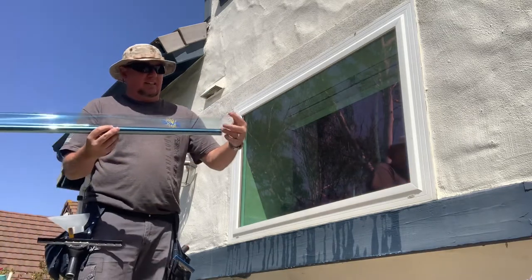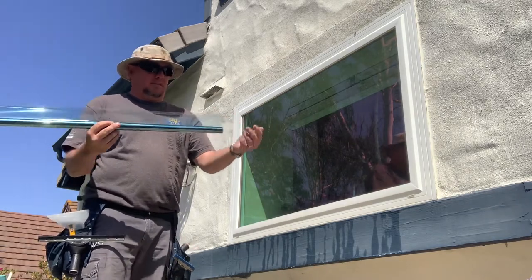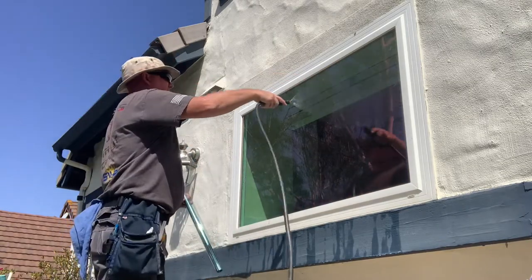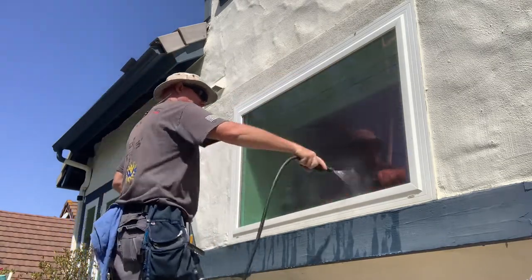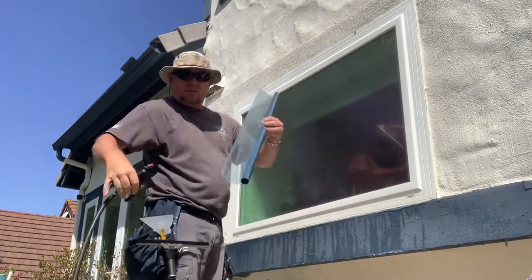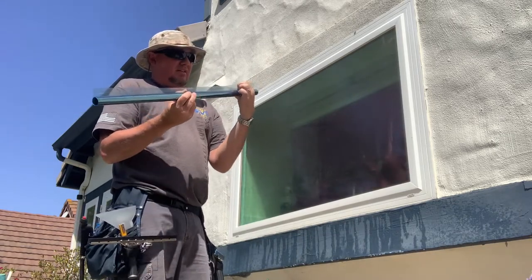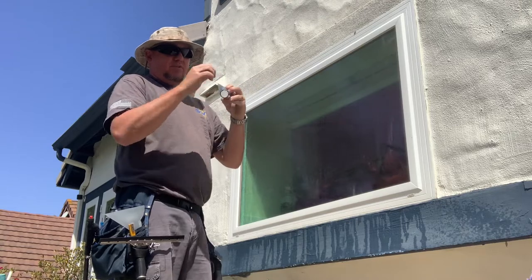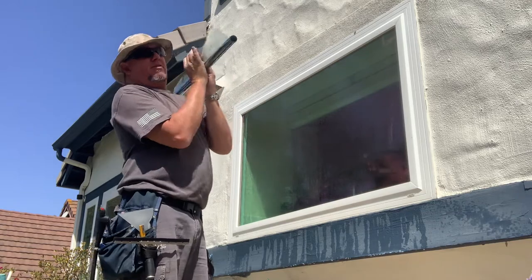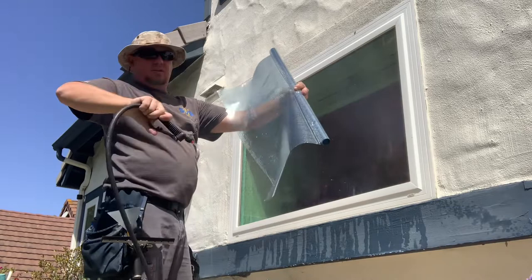The removable liner is on the inside. I used the piece of tape that came off of it to open up that liner. So let's give it a little spritz, get this nice and wet again. This is a wet install. Pull off any kind of contaminants that might be there. Wet the film. We wet the film a little bit so that the liner has a little bit of vacuum from the water to stick to itself. Open it up just a little bit — keep in control, close it down.